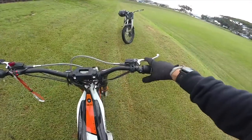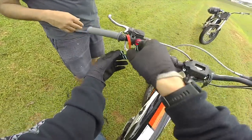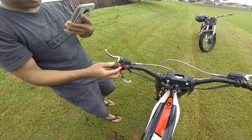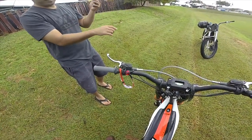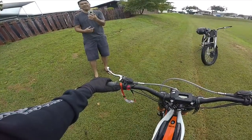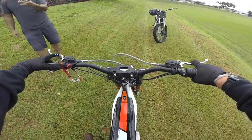It's so crazy to think about — it really is a real clutch, and you'll hear it whine. Also, if you're doing a trail situation where you want regen, we added this button here which is the same type of switch as the map switch. If you push this button you'll have regenerative braking feel — it's engine braking but it will regen just like the Escape's lever, but as a button. It won't have too much feathering effect, but when you push it it will brake. Going down a hard steep section this is basically your rear brake on the downhill.